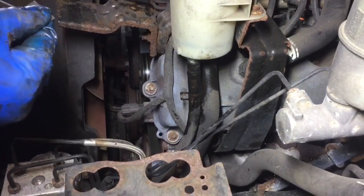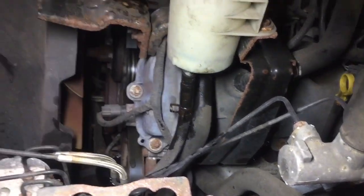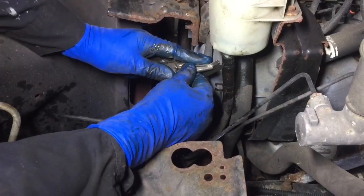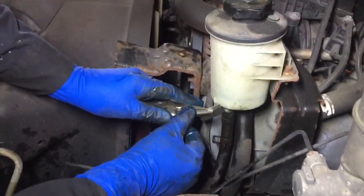They put a power steering cooler, and the line was basically just rusted out and dripping. So I'm being very careful here. This may get ugly. This is not the tool I want here. Look what I'm cutting, okay? On the side. Cut it like that. Jiggle it. Maybe you cut the first surface, but it should pop out of there. Let's cut a little bit deeper.